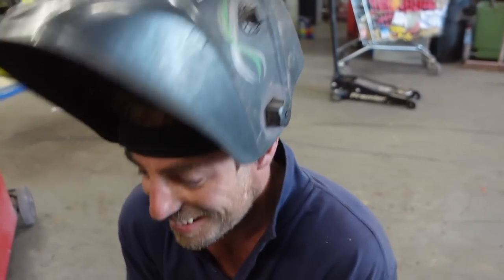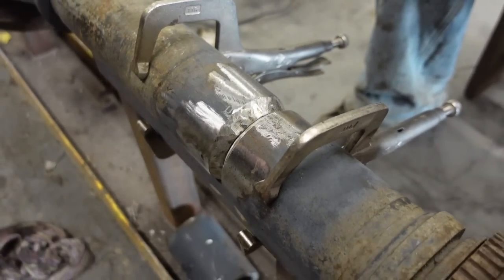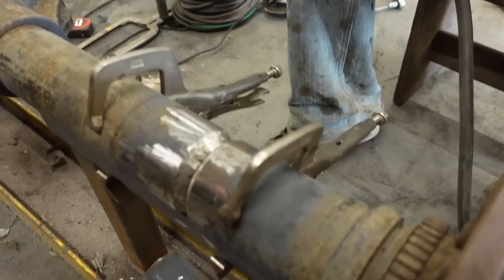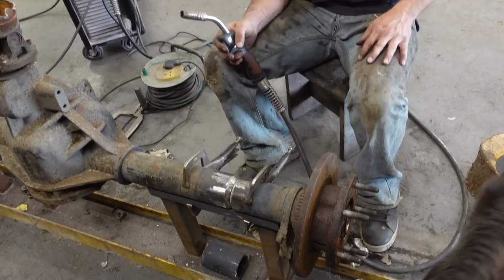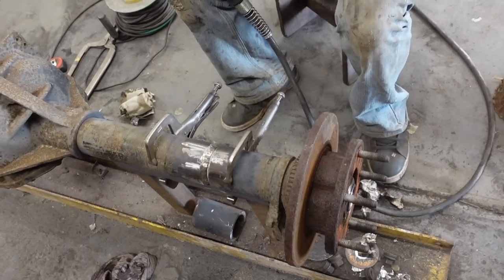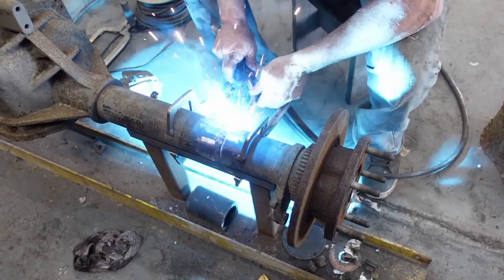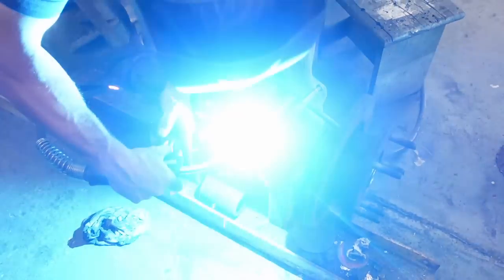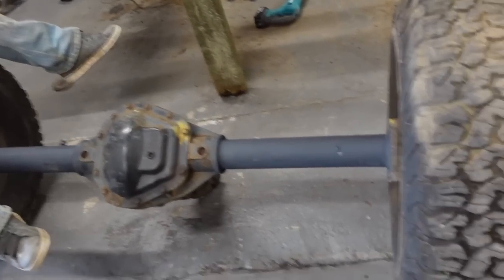It's going in. You've bevelled down to your 45 degrees, some description, give or take a few percent - it's tapered, give or take the angle of the grinder and how far off grinding we were. So now let's weld it back together, run it along those lines, see if we can get it straight. Axle - welded - done. She's a beaut.